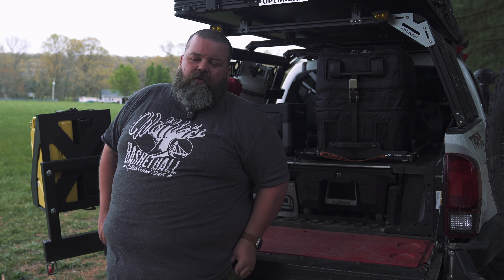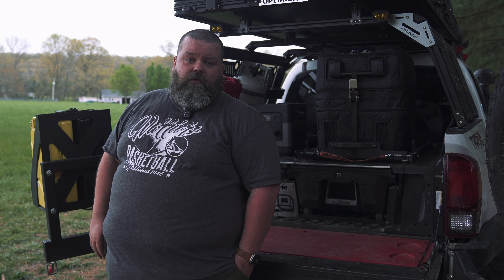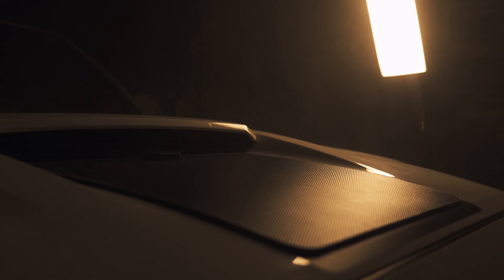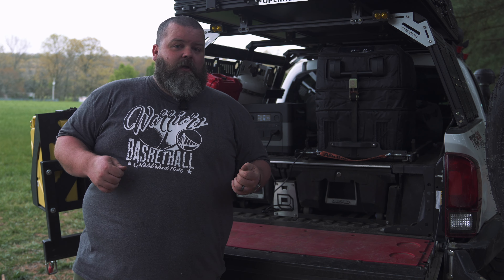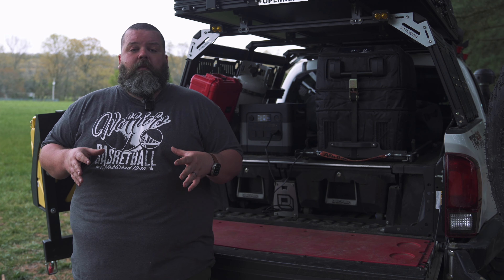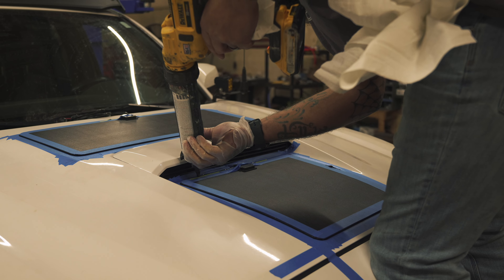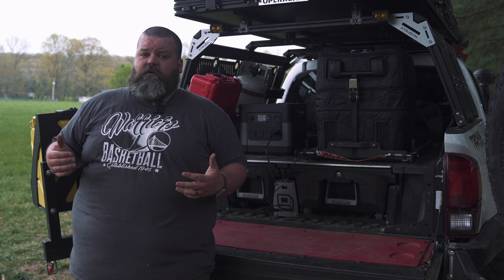We are four or five hours in the future. I let the fridge plug in and cool down. Something to note: I put it on max setting to cool it down fastest. It was about 75–80 degrees outside, coming all the way down to around 30 degrees, and on max it's going to chew through some battery. It ate about 10% of my Alek Hive, which is a 2500-watt battery. Normally I could run a fridge for three days on 10%, so it's worth noting that the initial cool-down uses more power — but once it's cool, it doesn't use much.